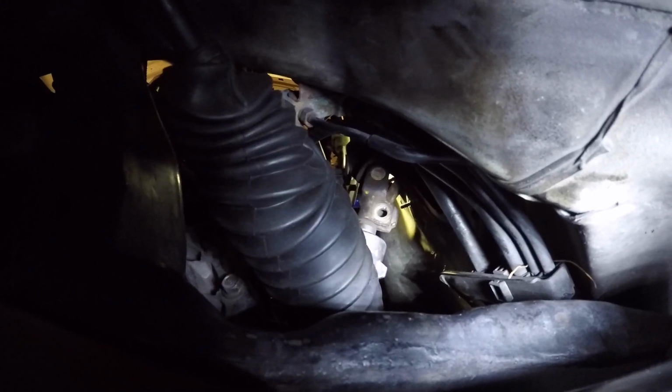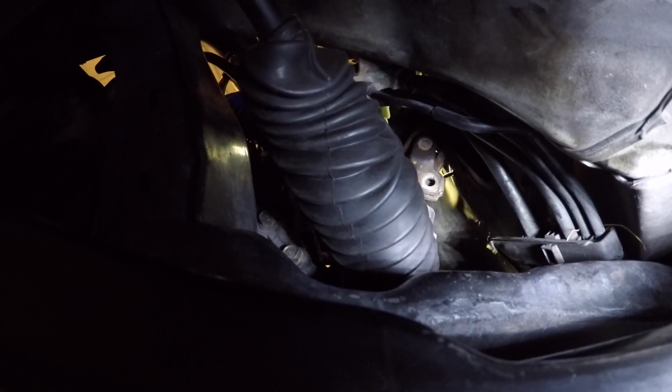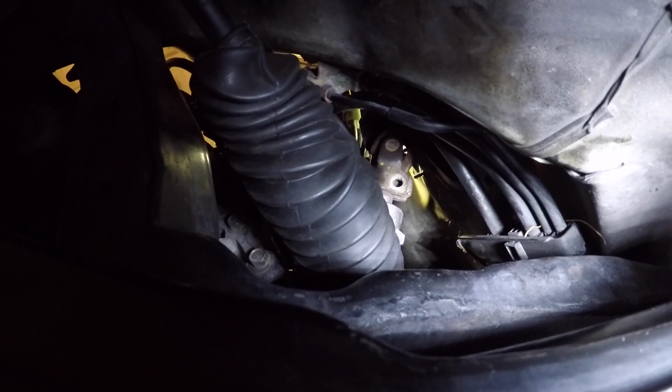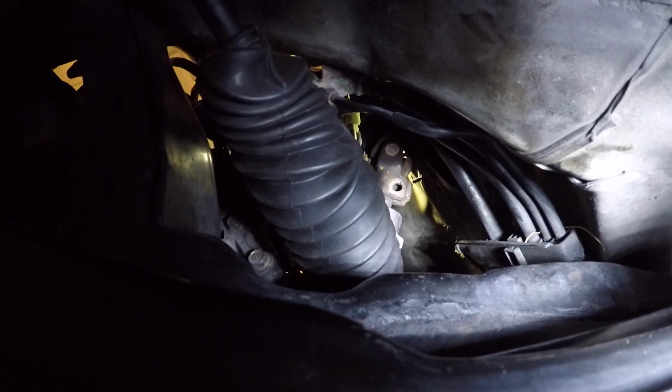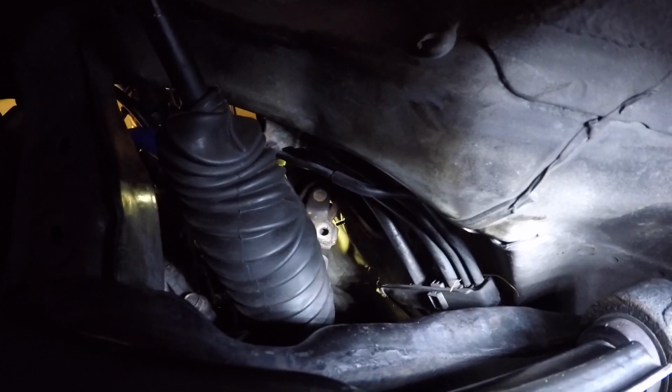Tires need to go to the right. So you want me to slide it off the rack? Yeah. If it can move, I don't know if we have to put the 3 bolts in here, which won't be stripped, I promise. I think if we undid the bolts under the dash, then you could spin the wheel freely like you want, right? Yeah. So we'll probably do that rather than trying to slide this off the teeth. Either way, they have to come off the teeth. Over here they do? Yeah. Well, they got to disconnect from the rack. Basically, either way. Alright, well, let me try that. Got them up there, we don't have to unbolt that. Alright, let me try to slide this in.